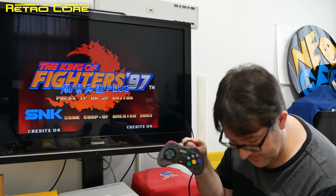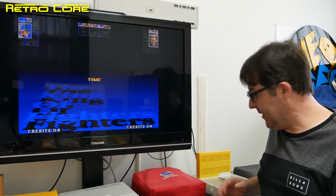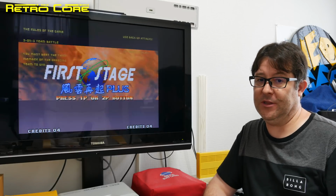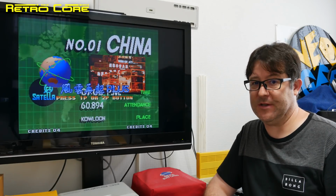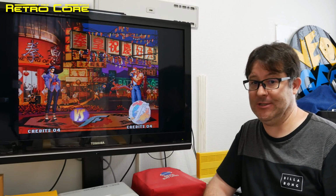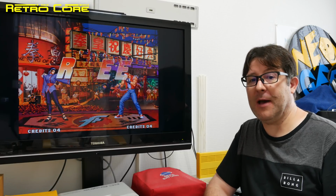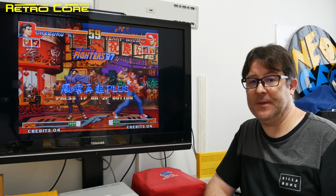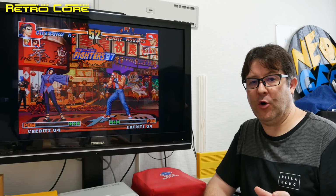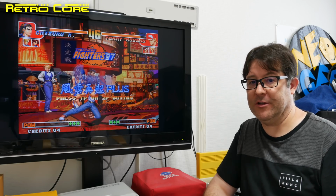Okay, now, one more thing with this machine, which might be an issue to some people, is that they've taken out the battery. And the reason for that is they probably didn't want the battery leaking all over the board, because those batteries are pretty old. Now, they could have put new batteries into these machines, which they haven't done, which is a pain in the backside. But to be honest, it's not that much of a difficult job to do. All you need is very, very basic soldering skills. Get yourself a battery holder, and the battery costs you $10 max, American dollars.